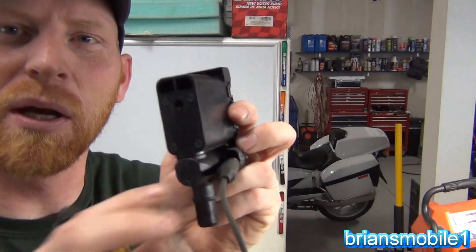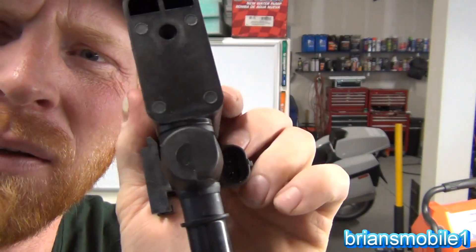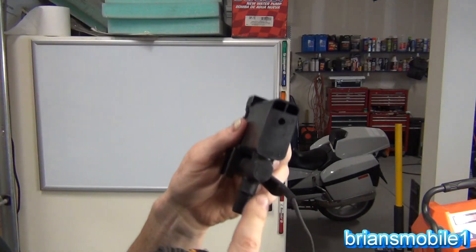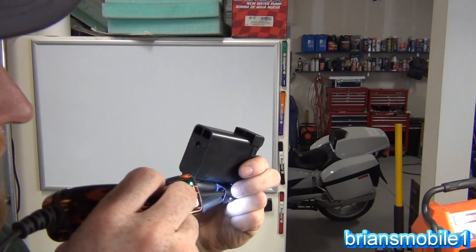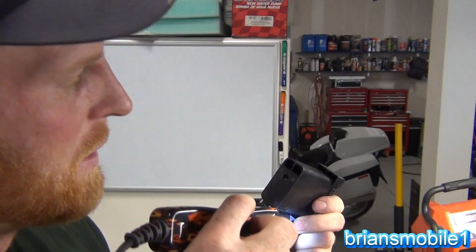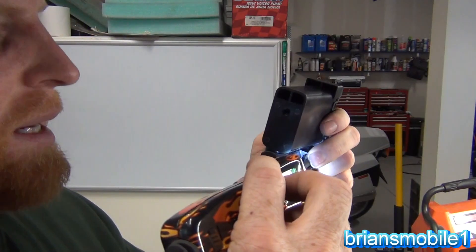You've got a two wire plug here. You can see the two pins right there. Basically with those two pins you've got a ground and a positive. The ground is the one that, if you point this to the ground, is next to it. So you hit it with power using a power probe — I'll put a link in the description for one of these; you need one of these if you're doing anything like this. You can hear that clicking — that's what a good one sounds like.